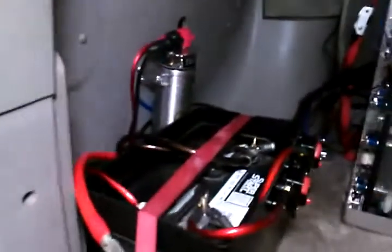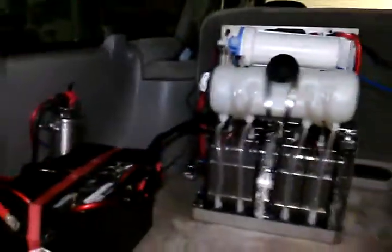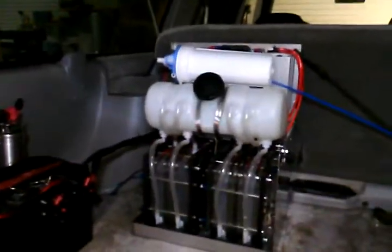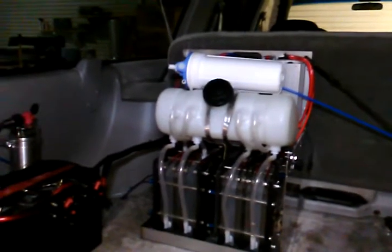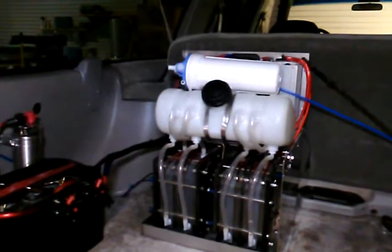You can see we have an external battery back here and a capacitor, and of course protection which is the circuit breakers. We have what we call a DC alternator on here — it's a 83% efficient 320 amp alternator, so it's about an $800 alternator, worth every penny.